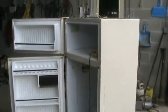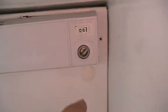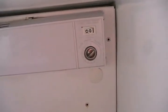Now the lesson on how to fix electrical problems with fridges, which is the most common problem you'll run into in fridge repair. Well, if the fan and the compressor never turn on your refrigerator, it's usually one of two problems. Since they're wired together, they should always be on together, but if you can't get them to turn on, it's very often the thermostat has gone bad, and one way is you can just punch it a little bit and see if that switches it on temporarily.